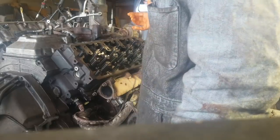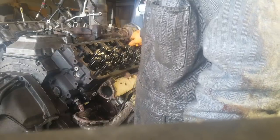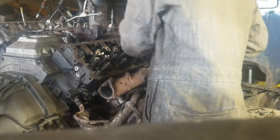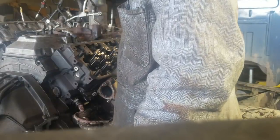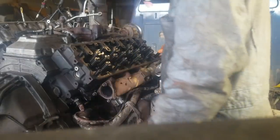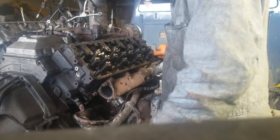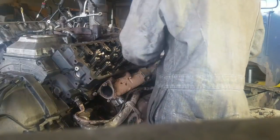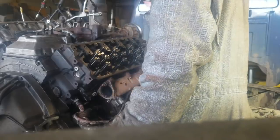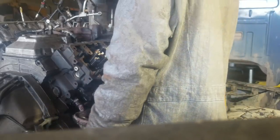Okay. But on some of the other head bolts on other engines, you're putting them in with a wrench or whatever. A lot of Cummins motors and Cat motors, we've always taken those head bolts and just run them down with an impact. Well, the danger of doing that with oil in the bottom of the hole is you've basically got a hydraulic cylinder there. Just think of that end of that bolt as the hydraulic piston, and that fluid's on the bottom, and you're trying to compress all that fluid in there. Well, it'll crack the block. You can ruin a cylinder block doing that if you don't have enough common sense to stop. You can really screw things up. So be real cautious and get all that fluid out of those holes. So anyways, once you get all your studs threaded in till they bottom out, then you're ready for torquing.